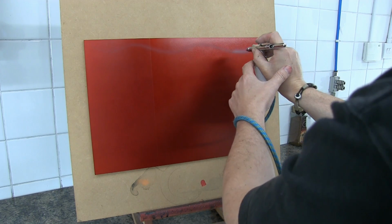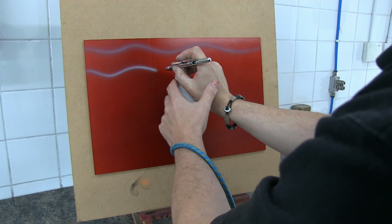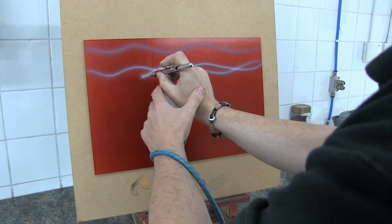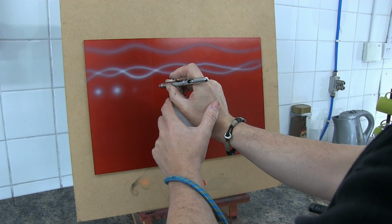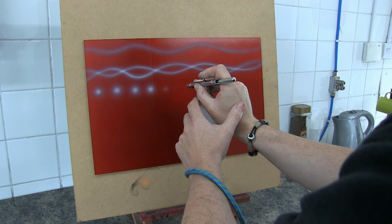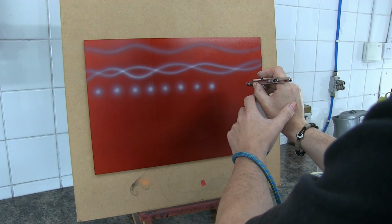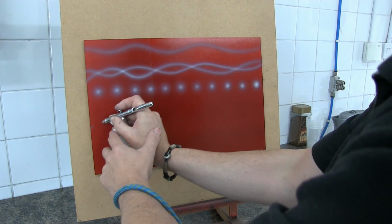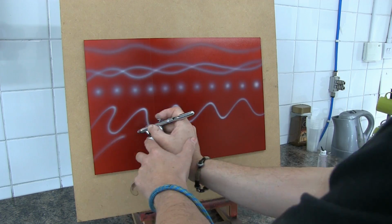So I'm just using a 0.5 airbrush here. This is transparent auto air white, and I've got about, I'm guessing, 30-40% 40-12 reduction in here. Candy bleed is very undesirable. What happens is whenever you clear coat, the candy actually gets drawn up into the clear coat, and unfortunately, it brings every other color with it. It's notoriously bad when you're airbrushing white over red, hence the demo I'm about to show you here.